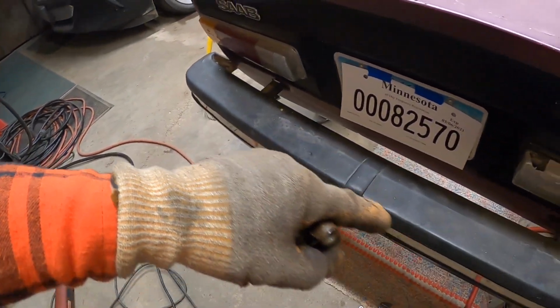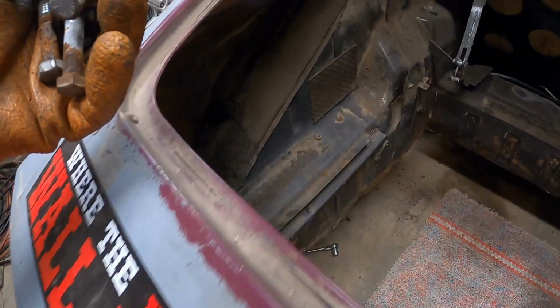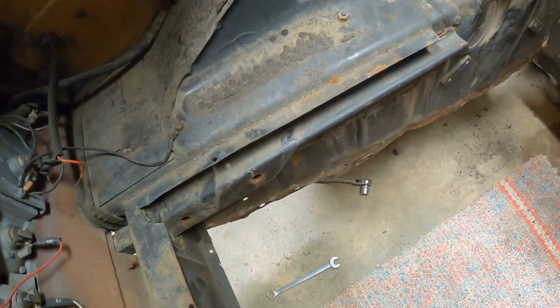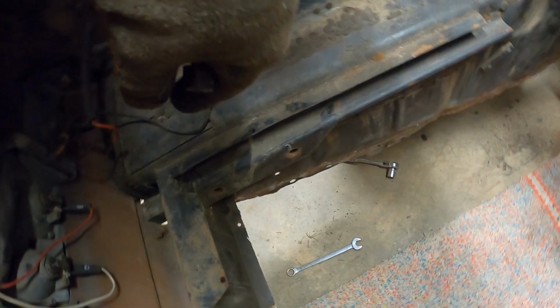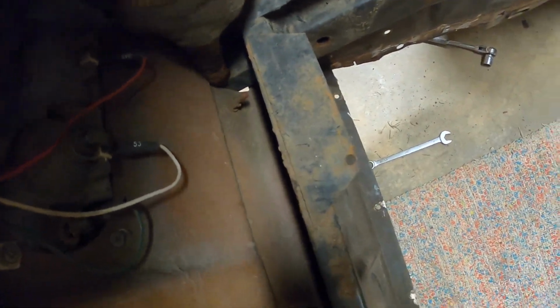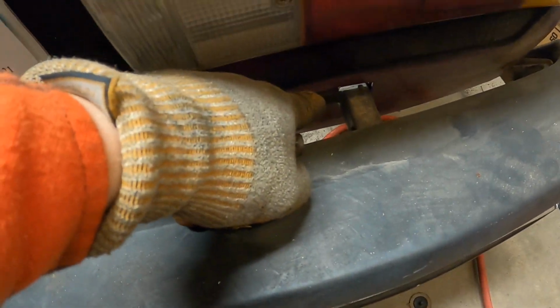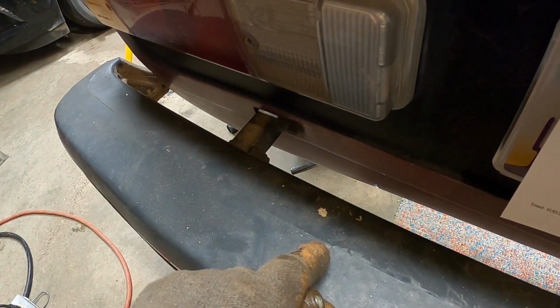So you're going to pull your US bumper off your Sonett, yanked on your rusty nuts for about 20 minutes. Are you ready to pull it out? Wait, there's more. Check out, there are 2 more bolts that hold the bumper mount to the body, and they come on in here. Make sure you get those out or you'll rip your fiberglass really bad. Ask me how I know.